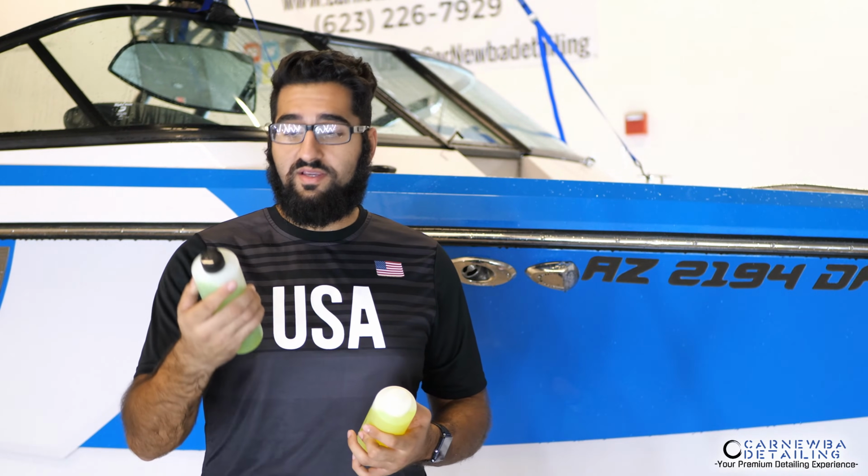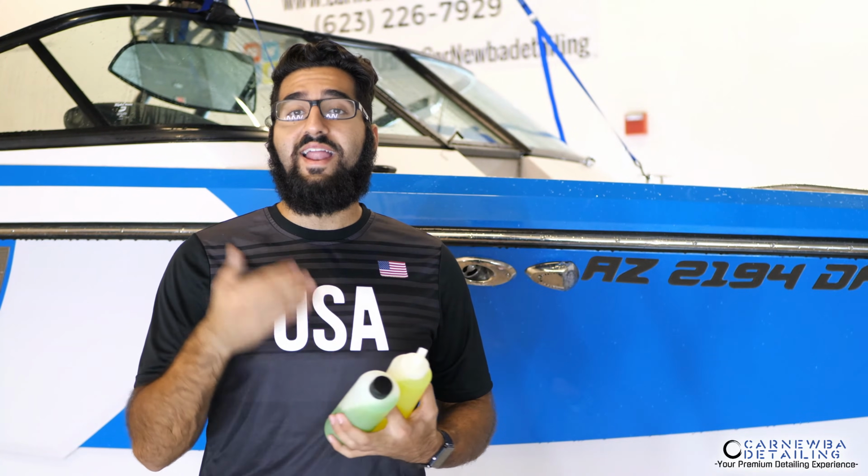And I'm going to go ahead and mix some MAC all-purpose automotive extreme cleaner. Now this is also alkaline based as well, so we're going to go ahead and neutralize the acid based cleaner that we just performed on the vehicle, and making sure that that acid does not continually work on the surface of the gel coat.